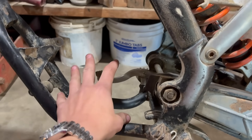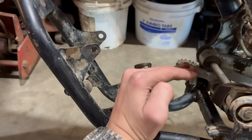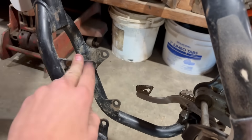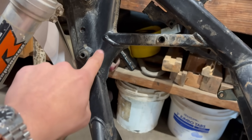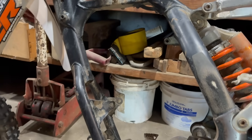When it sits on this mount, I have a ton of room for a motor — my motor is only going to go up to maybe here. So I can lower this battery down another four inches. I'm going to cut out these mounts because I don't need them, so I can get the battery lower. And with that, I'll probably only have to cut a little bit here and maybe this bar. Let's see if it fits.